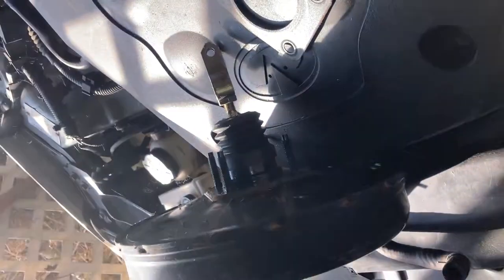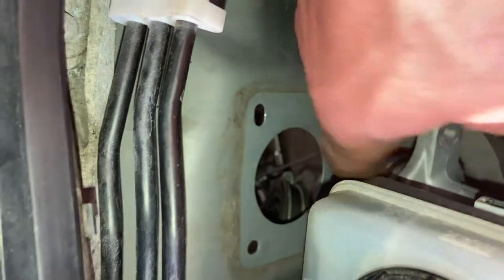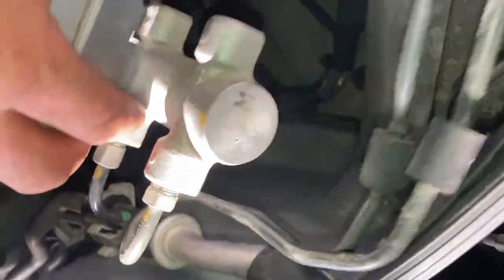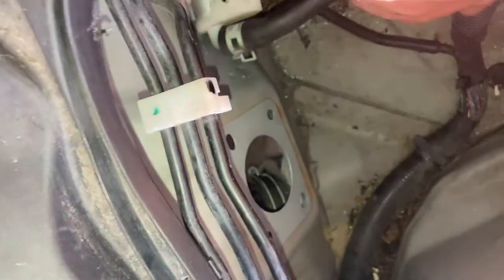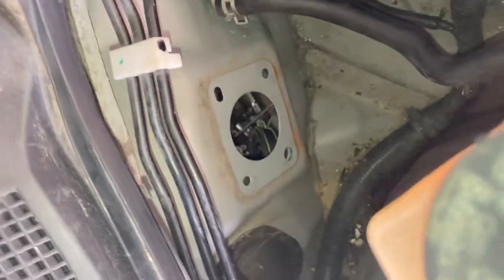I got to put my brake booster back in — there's my brake booster — and there's a flange for it. When you tear this out, that flange goes right up against here. What I'm going to do is take this piece over here — it's malleable, it'll give you some leeway. You just prop it up there, it hangs right here on its flange, and you can slip the booster down in here. You have plenty of room to kick it in. It's kind of a pain to squeeze out of here, but I got it secured and centered.